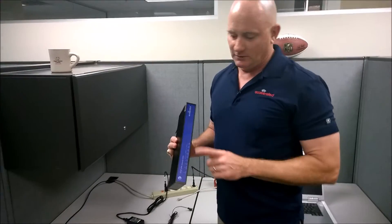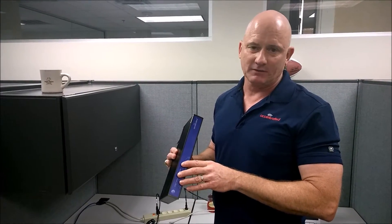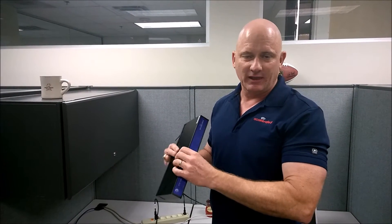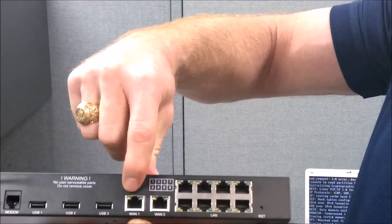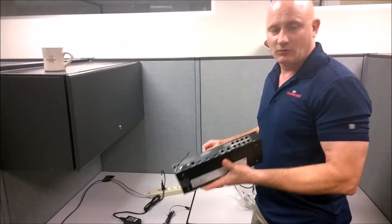With the AT&T 8200, this could have a configuration for a fixed IP address on the WAN port or something else. So we want to flash this back to its original settings first, and then we'll let the laptop update it to the latest firmware. The port we're going to use is WAN 1 — every time, this port — we're not going to use any of the other ports. So we take the ethernet cable and plug it into WAN 1.